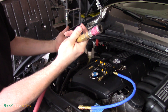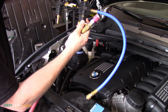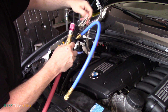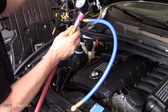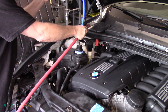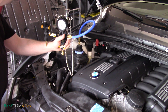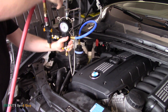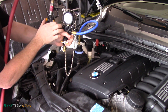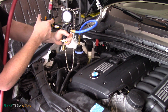All we need to do now is grab your air hose and we're going to pull a vacuum on this system. It's pretty simple. I can't hang this from the hood latch because the latches are off since I've got to paint it, so I'm just going to hold it for you guys. This has two valves - this one's closed, this one's open - and we're going to turn our switch on and draw a vacuum.